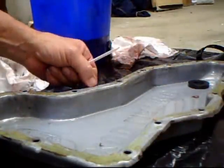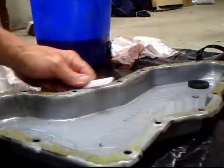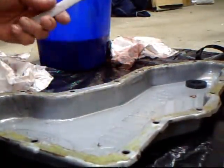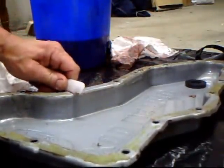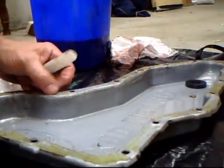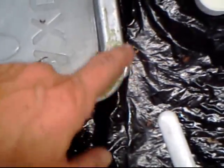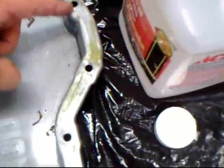I've wiped everything clean as a whistle, all the way around, and the filter looks good. It specifically says not to use any kind of silicone on this gasket — you just don't do it with a rubber gasket. I'm using a nylon scraper because the only thing you should scrape this with is a nylon piece of plastic or your fingernails. One of the problems is if you put sealant on, you've got to put it all the way around the holes, and if you look at this, it's only in between the holes.